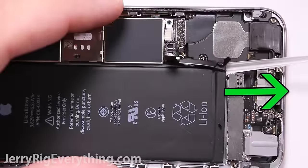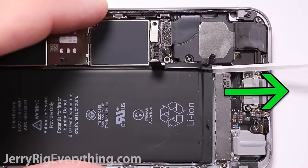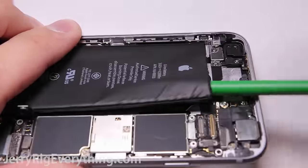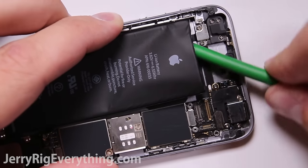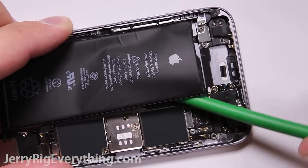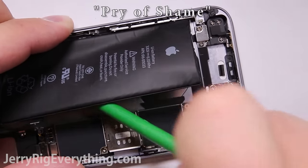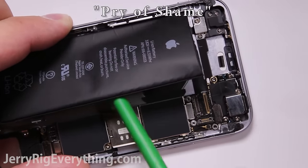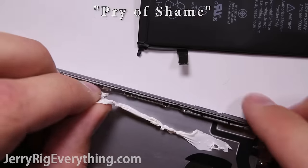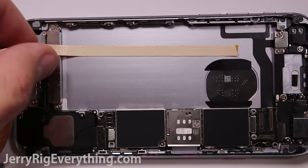Just pull straight out the bottom and you can see it pull entirely away from the battery — so easy. That's one whole half of the battery that you don't have to unstick from the back. But since I messed up the first pull tab, I have to do the pry of shame to pull the battery out from the back of the housing. The sticky tape is pretty strong, so the best way is to pull a little tab out from the bottom of the battery and yank it right out.